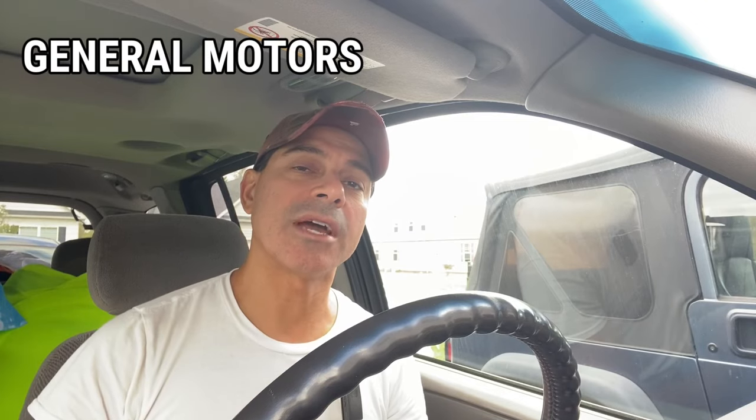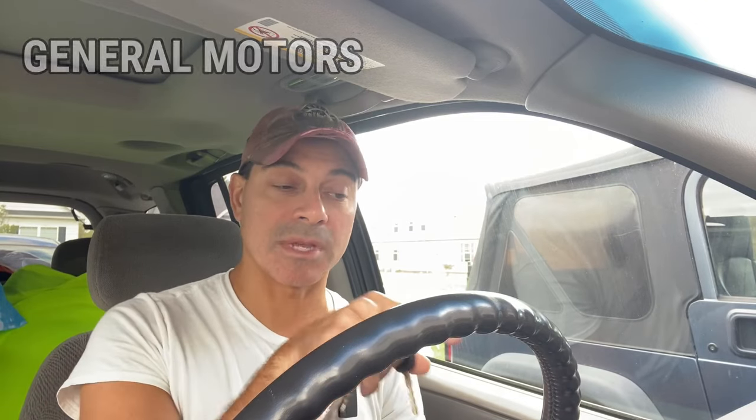We're inside a GM vehicle now, and I know that this vehicle has some engine codes already. We're going to see if this technique will work. I haven't had much luck with GM vehicles using this in the past. Chrysler products usually are the easiest ones to accept that process and display the codes. But with GM, sometimes this will work and sometimes it won't. Sometimes you have to hold down the trip reset button when you do it. This particular one is a 2003 Chevy Trailblazer EXT. Let's go ahead and try it.